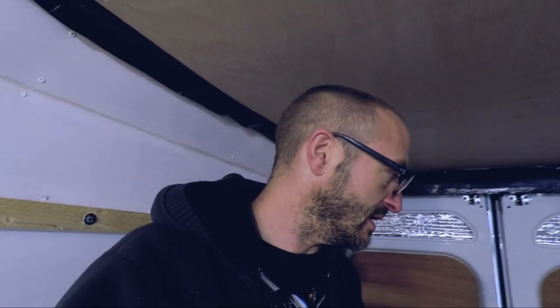The big job for today: deadlocks for the van — they arrived. I have been putting this job off because it's another cutting holes in the van job. I've got some metal-friendly silicon for sealing up afterwards, I've got some step drills, rivets and a rivet gun. I've got a lot of coffee and about five hours of daylight, so hopefully that's enough to do at least the cargo area.